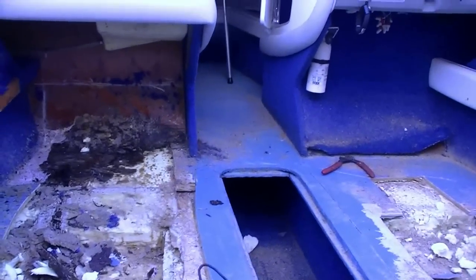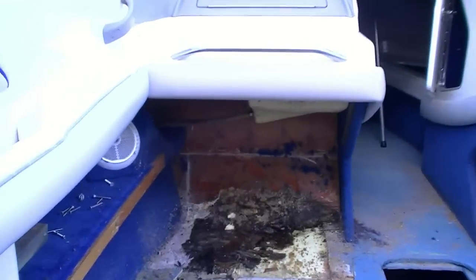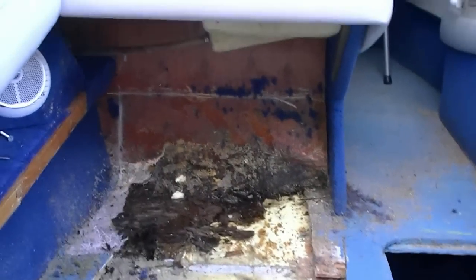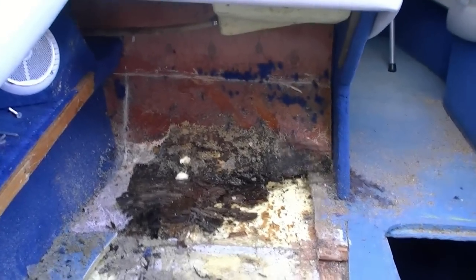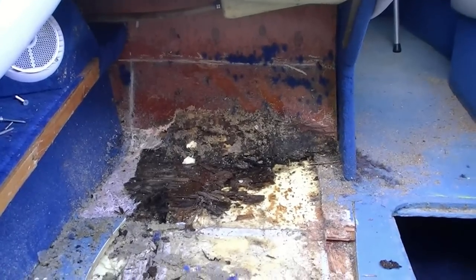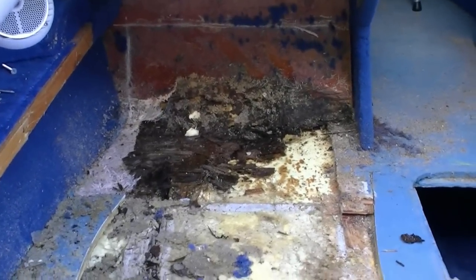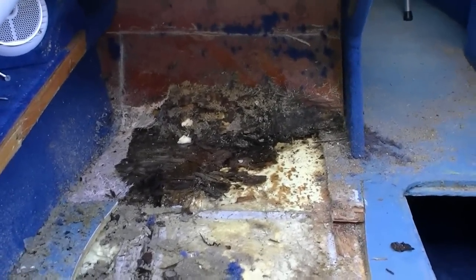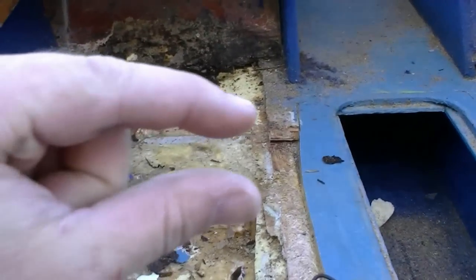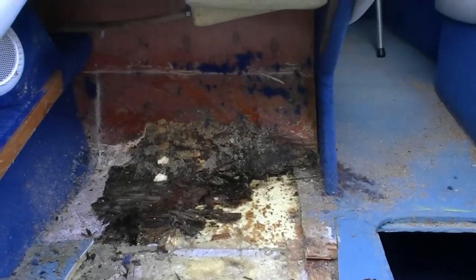It's a new day and the rot just keeps going. That right there took me damn near two hours to get out. When they redid this deck to cover everything up, they just put super, super amounts of fiberglass and resin over the top of it to make it look like it was strong. As you can see, it is just completely rotted. It was not soft — it was as hard as a rock, but it had probably a half inch of matte and fiberglass on top of it, so you didn't see it.